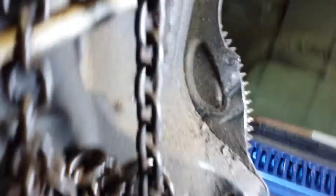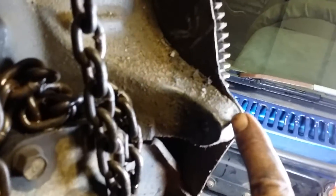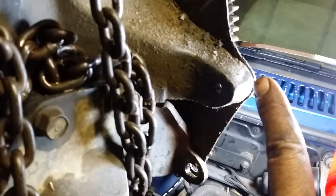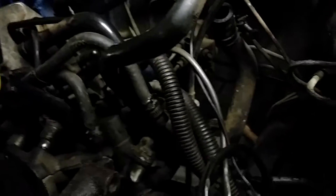There are also some smaller bolts that hold down the plate — there's a hole right there for the little one. There's a bracket down here that also needs to be done. The main four bolts are 17 millimeter; these smaller side ones are 14 millimeter. You take all of them out and pry it away — you're really tilting that transmission and prying it off the shaft. The shafts are fine; they didn't break, strip, or get the splines gnarled.